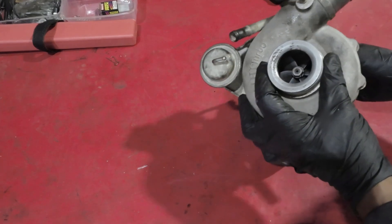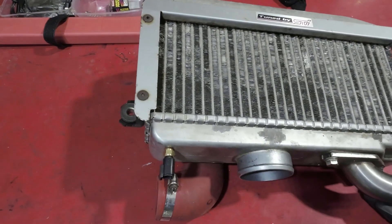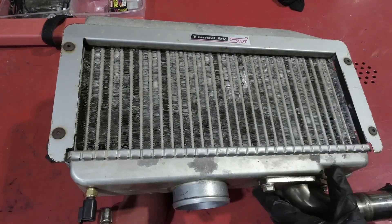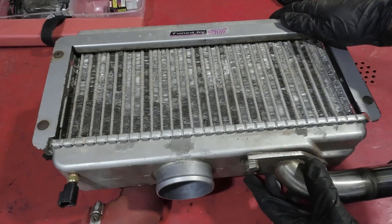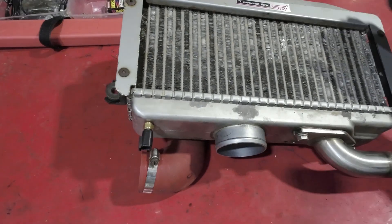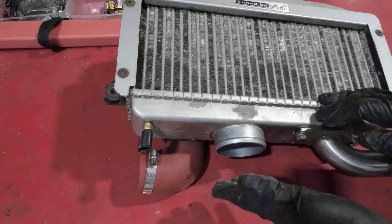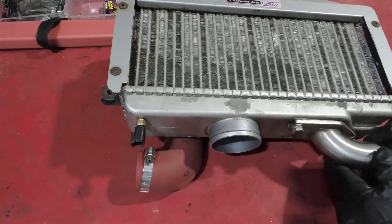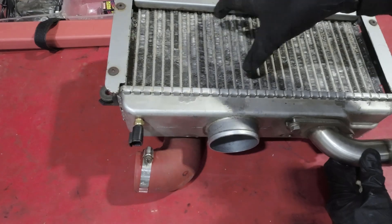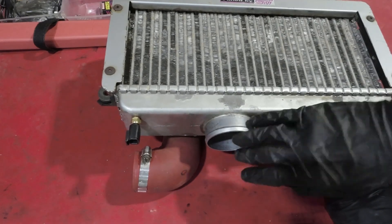What we need is cold compressed air. And that, ladies and gentlemen, is where this gadget comes in — this is called an intercooler. This one is off a Subaru. There are a few different types out there; this is what they call a top-mount intercooler. Basically, this kind of looks like a radiator — and you'd be correct, it is a radiator that cools down air. The hot air out of the turbocharger comes in on this side, enters into the intercooler, and exits into the engine. In the meantime, cool air rushes over the bonnet of the Subaru through the iconic bonnet vent, goes through these fins, and on the way through takes the heat out of the compressed air — or boost — before it goes into the engine.